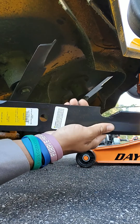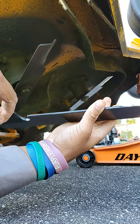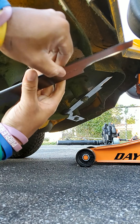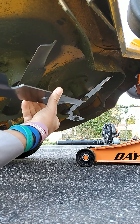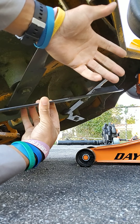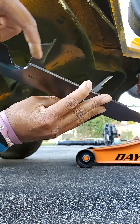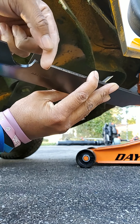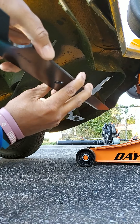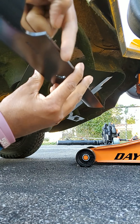Something else I want to mention: your blades are directional. Basically, spin it in your hand to see where the cutting part of the blade is. Picture yourself mowing grass — you want the blades to be cutting the grass, obviously. Spinning it in your hand will show you which way your blade needs to go. You've got your lip and your lift on the back side of the blade. If you spin the blade to the right, the cutting part is not engaging the grass.